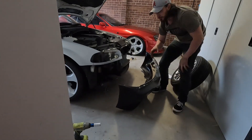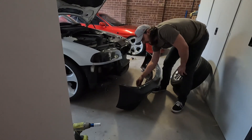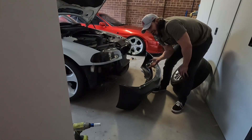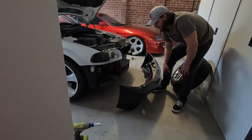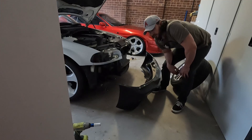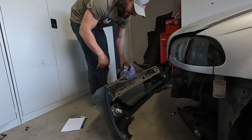Those little bits that look difficult were just the two fog lights and the horns. I'm actually going to take the fog lights and housings out today as well because that needs sorting out. All I have to do is whip the bumper off, and when I put the bumper back on I'm just going to put the two big bolts in because it has to come off for the paint job anyway — just makes it easier.